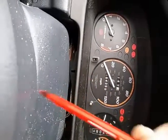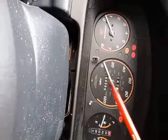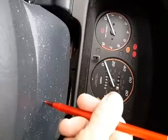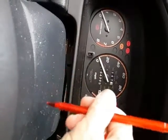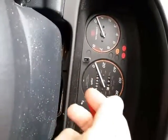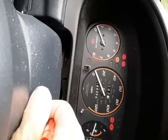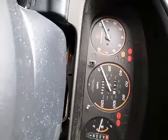There are two-digit number codes — say like 65. So if you see six long flashes and five quick ones, that would be a number code. The long flashes are always the first digit of the number. You might have more than one code, so keep writing them down and counting until you see all the numbers or they're just repeating. Then you've got the codes. You can just go online and look up your Honda codes to see what it's reporting as a possible problem. And that's about it.